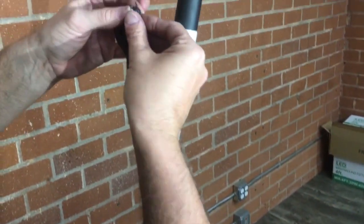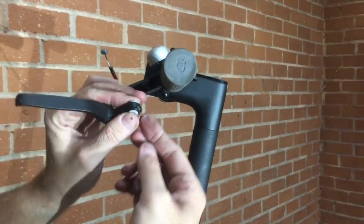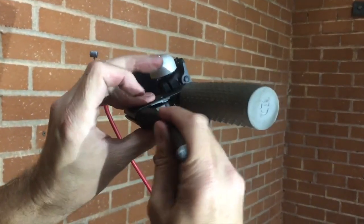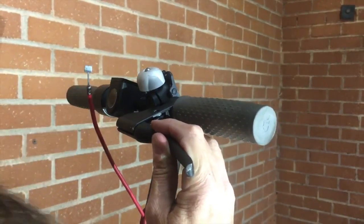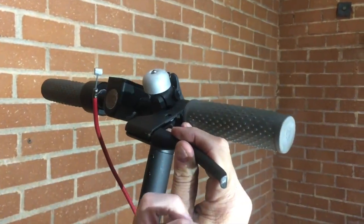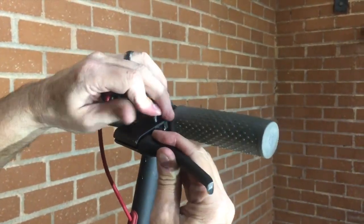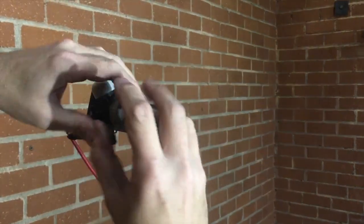Come back up to the perch area. Make sure the little tab on the spring is seated in the back area. Put the whole assembly back into position, making sure it's all lined up with the holes. Take your pivot screw and come back in from the top, pushing it through as it goes through both sides.